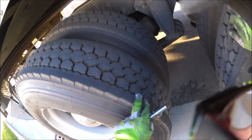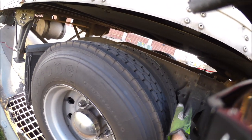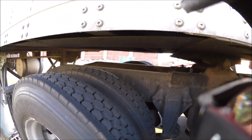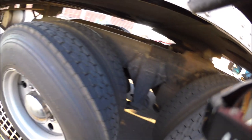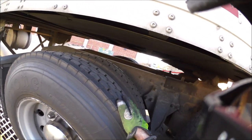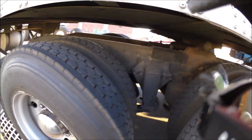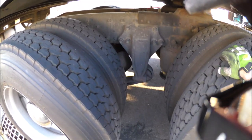I try to do it in the fall and swap them where the front tires go to the back. You try to rotate so you don't have to replace all eight. You want to keep the meat on the back because that's where the drive is. When you get new tires, always put them in the back, put these in the front, then the fronts get retreaded and go to the trailer. That's how you rotate them - I work that out in spring and fall.